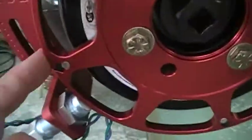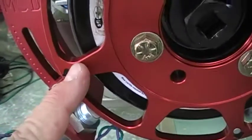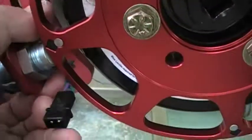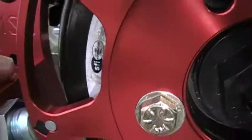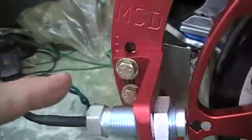Our flying magnet is right here in this position. So we want that firing with the magnetic pickup right when it's at this position. We'll move the adjustment up to where the pickup is exactly in line with the magnet. We'll go back and tighten these later.